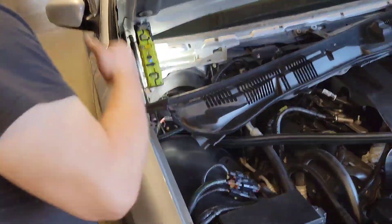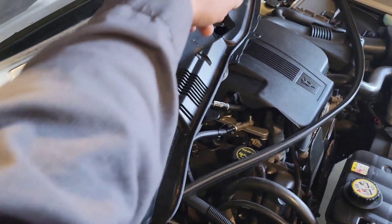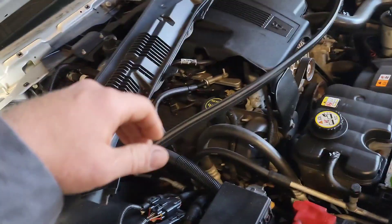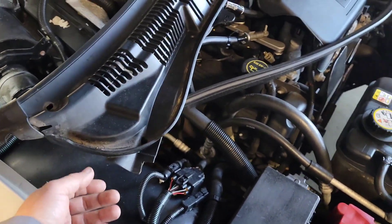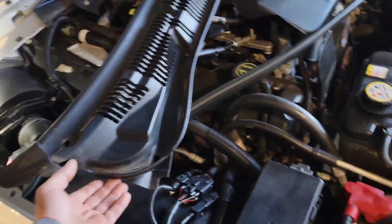We got the Grand Marquis in here and the plastic panel is pulled off. They've got a quick release lever on the wipers to pop them off. Pull your Phillips screws out of the locations in the plastic and then there are a couple push pins. Once you get the Phillips screws and stuff out, you can just lay this off to the side.